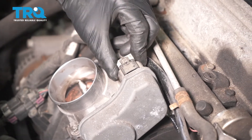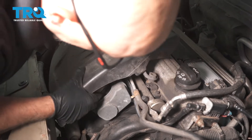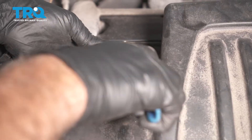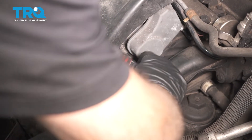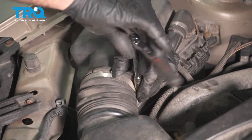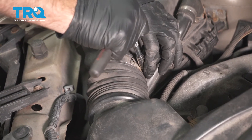Take the connector, line it up, lock it down, and push down on the lock. Now slide the intake into position — make sure you line the hose up on top, and then slide this over the throttle body and over the airbox. Move the clamp over, slide that into position, and tighten this worm clamp down. Make sure it's snug, then do the same on this one and snug it down.